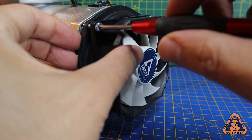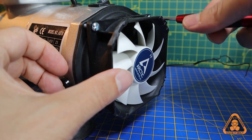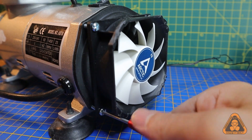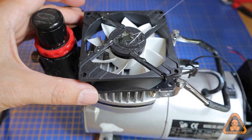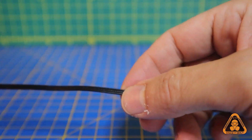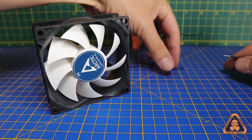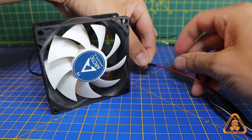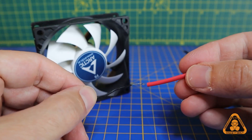The fan does need a slight modification by trimming the corner brackets so it can fit the replacement longer screws, which need to go all the way through the fan and vent panel holes. Although the original screws would work if the vent panel was discarded, it's best to keep it as it covers the exposed power terminals inside. The second fan is hot glued to the top of the fins where the compressor also gets really hot. These fans have three wires ending in a PC circuit board plug — the plug isn't needed and can be cut off, but now the positive and negative wires need to be identified by trial and error using a 12-volt power supply. Then cut off the redundant third wire and mark the remaining wires so you know positive from negative.